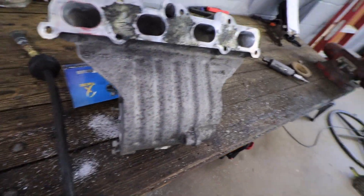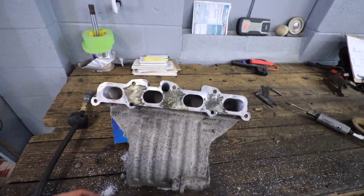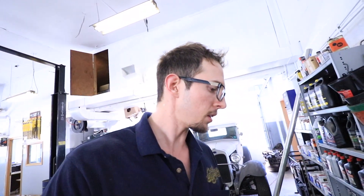Now I've got to clean this thing up big time because there's a lot of metal in it and around it — if I let that go we're gonna get metal in the engine, and we can't have that. For now I'm gonna take the air hose and blast it out as best I can, then run some brake clean through it so it evaporates quickly and doesn't collect water. But before I go and assemble it I'm definitely gonna do a super clean just to make sure there's nothing in there. I'm not gonna show that — it's very anti-climactic. Anyway, if you guys have any questions let me know, like the video, subscribe — you know the usual stuff. Other than that, I'll see you guys on the next one.